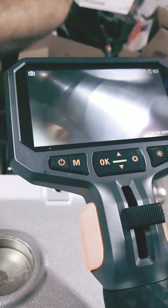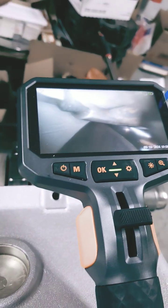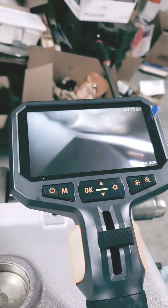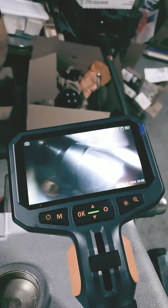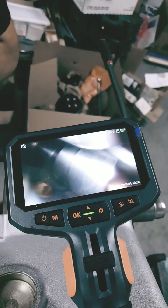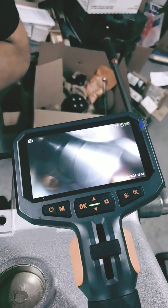What we did was we got a pin gauge set, and we're putting an 80 thou pin gauge in there to check our clearance. We got plenty — they say you need 60, we checked it with 80 and got plenty of room in there. There are four journals that we're concerned with that are really close, and we're going to check all four of them.